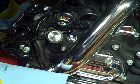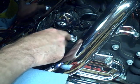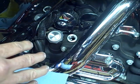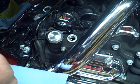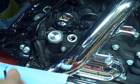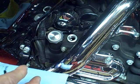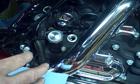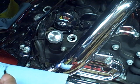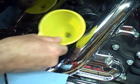Once you get your transmission oil drained and your drain plug back in, you can add the new oil. Take out your filler dipstick cap and set that aside. Harley-Davidson makes two types of oils for this transmission: one is called Harley-Davidson Formula Plus Transmission and Chain Case Lubricant, or you can use their synthetic Syn3, which can be used in the transmission, engine, and chain case. So that's what I'm using — a synthetic. This transmission holds 32 ounces, which is exactly one quart, so go ahead and add the one quart.